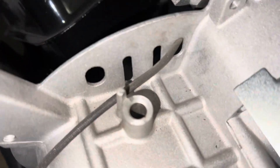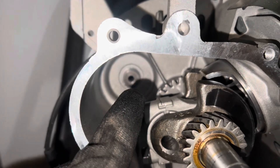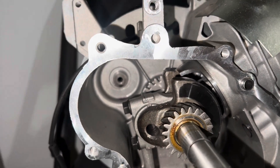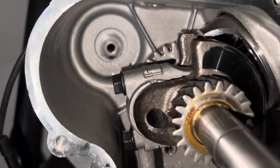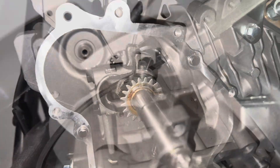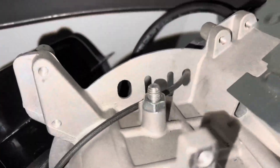There are some washers — one right there and there's one on the pin. If the one on the pin or that one gets stuck, make sure to get it out — that little washer — so it won't fall out while using the motor and mess everything up. Since I don't have loctite, this is what I did with the holes.